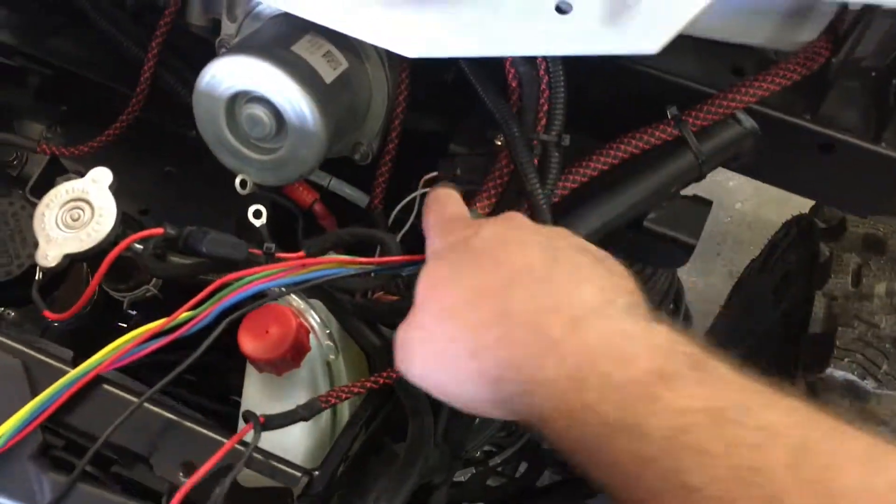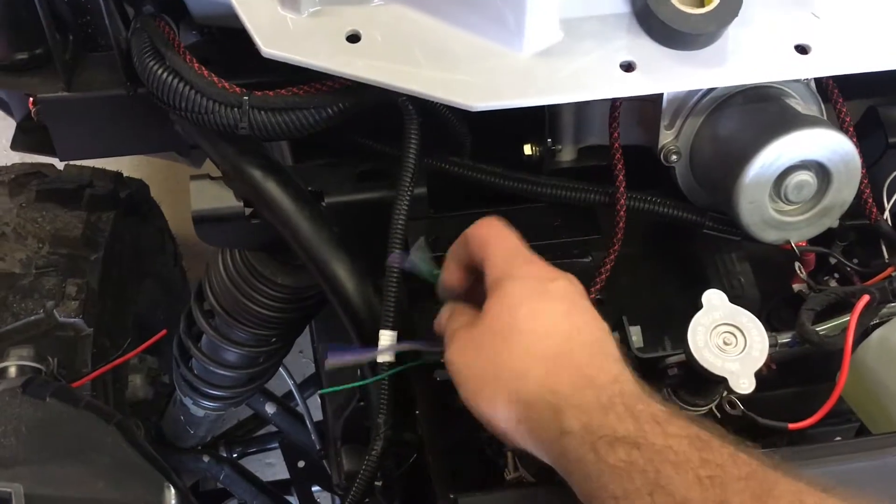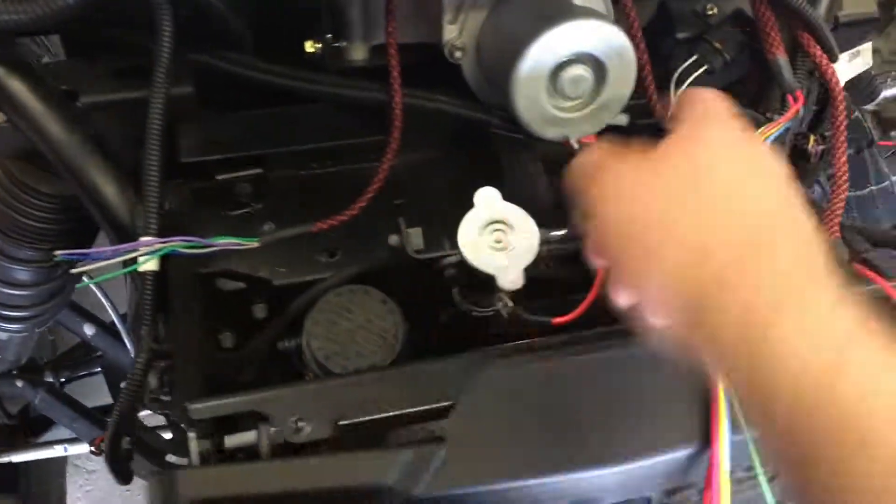With this shock strut mount, I touched up some paint. I drilled a hole, screwed in there, took a conduit clamp, bent it, cut it down, painted it, and bolted it on top. It's very sturdy - not going anywhere. It's got an integrated horn, though I'm not running a horn right now - I don't have it wired.